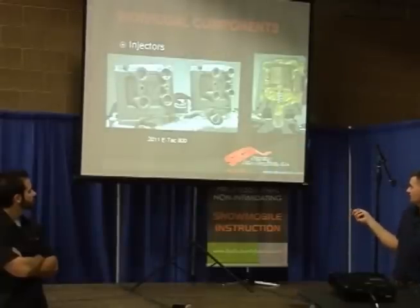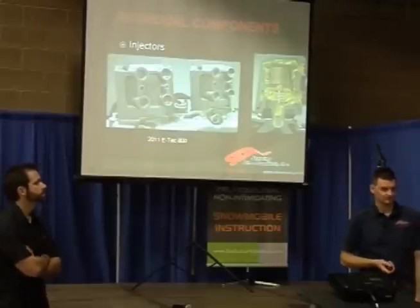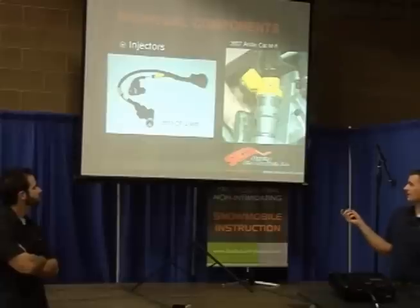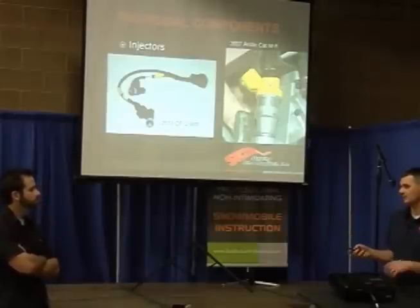So those are very, very different systems. The injector is quite large — that's the cylinder head right there, there's the spark plug, you can see the size of the injector. Because they're running so much fuel they try to keep the system very cool — the fuel does cool the system quite well. However, these systems can heat up if they're overused, if the duty cycle is pushed past 90% for a long period of time.